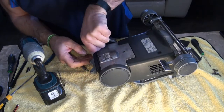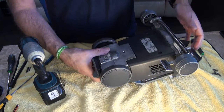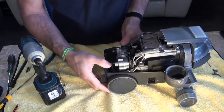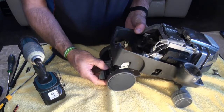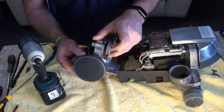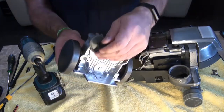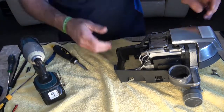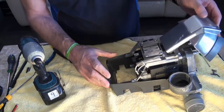You need to drop the tech drive out — get those to one side, just make sure that's in drive. Flip it over and she should drop straight out. Remove the belt and put that to one side. I've got a video where I replace this tech drive and I'll put a link above for that. It's a pretty simple process — that's just an Avalir tech drive that's actually in there now, as the G4 did stop going backwards instead of forwards.